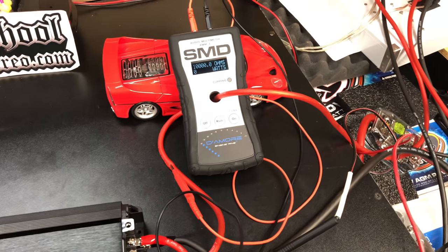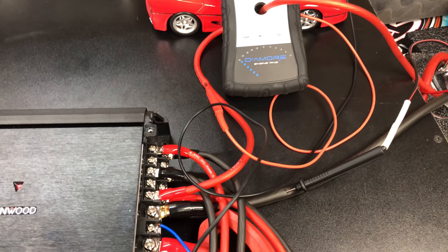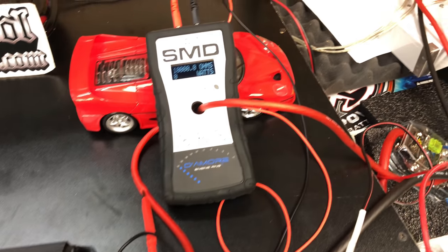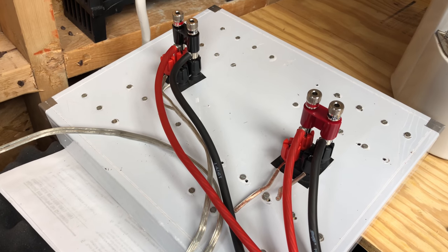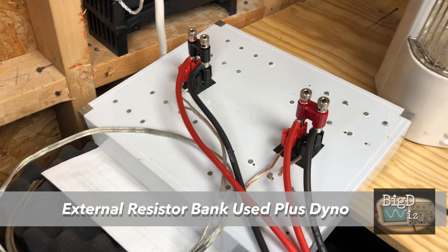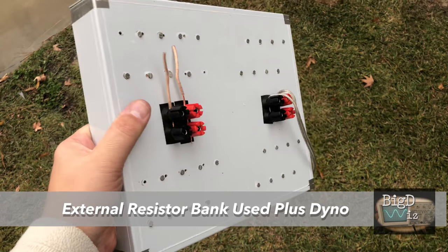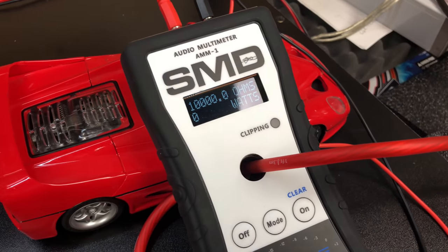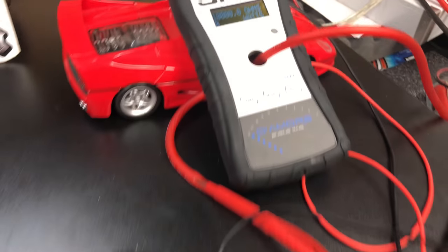In order to make the measurements more simple for my test here, what I decided to do was use a three channel mode on both amplifiers. The front and rear channels were bridged plus the subwoofer, and they were all hooked up to resistors using either the amp dyno's built-in resistors or this external resistor bank I built. That way we can ensure all channels are loaded during these tests and we're getting accurate numbers just like you would in your car.